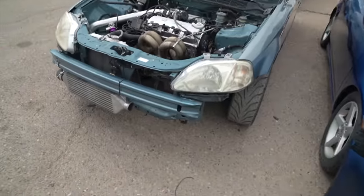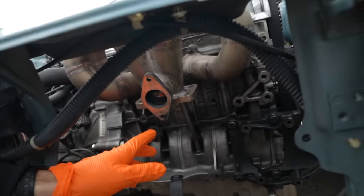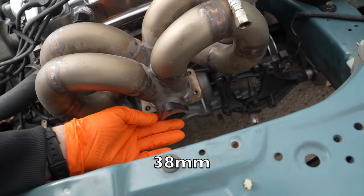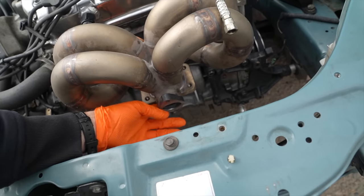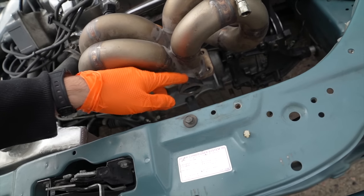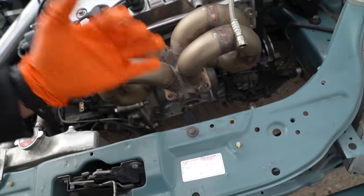So yesterday we ran into a little bit of a speed bump with this turbo manifold. This flange for the wastegate, a 30 millimeter two bolt flange, was right in the way, touching the end of the turbo housing. So I actually have a V-band 44 mil wastegate. We're gonna cut off some of this flange, weld that on here, and then put the turbo on here.